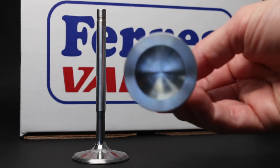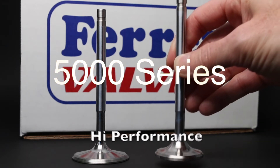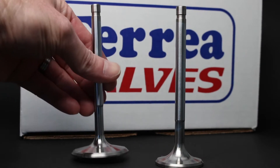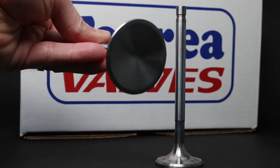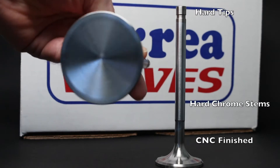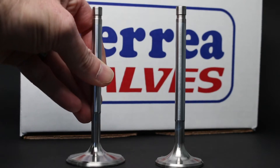Let's go over the 5000 series. Great for high performance applications. No turbochargers, superchargers, or nitrous. Maximum spring pressures should be kept between 150 to 200 pounds on the seat. Manufactured all in one piece, they're CNC finished, they have hard chrome stems, and they also have fuse welded hard tips.